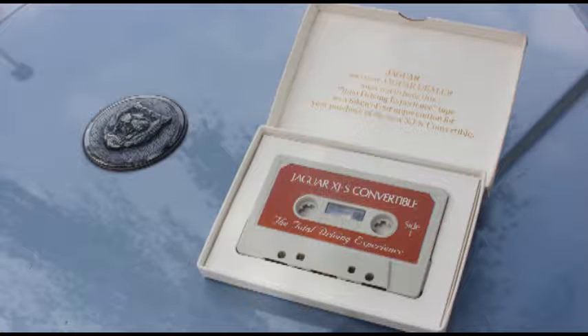For safety and convenience, your Jaguar is equipped with a central locking system, which is activated by either door lock mechanism. Moving the vertical lever in front of the interior release handle toward you to the lock position simultaneously locks both doors and the trunk. Three different keys are supplied with your XJS. The large black-topped key is for the ignition only. The all-metal dome-topped key locks or unlocks both doors, the trunk, the fuel filler flap, the glove box, and the rear storage compartment. The metal key with a concave top locks and unlocks only the doors and the fuel flap. If at any time you leave the car with a parking or garage attendant, you may, if you wish, leave only the ignition key and the concave key. This will prevent access to the glove locks, trunk, and rear storage compartment, providing they are already locked.